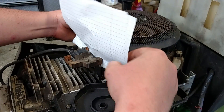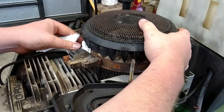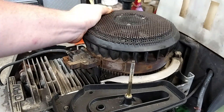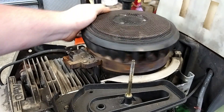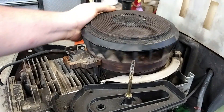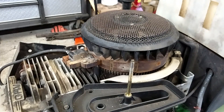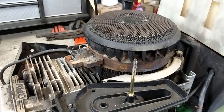All you do is rotate the flywheel out to get all the pieces of paper out, just like that. If you question your gap at all, rotate the engine all the way around just in case you find it rubbing in one area of the flywheel. This feels good — I've rotated it all the way around, back to the magnet. That's the simplest and easiest way to gap a coil. I'm going to move on to adjusting the valves, so if you're interested in that, keep a lookout on my channel for that video — it should be up shortly.